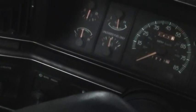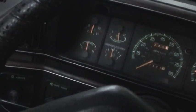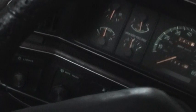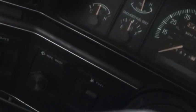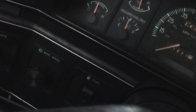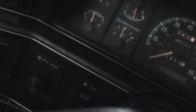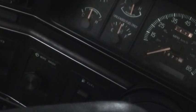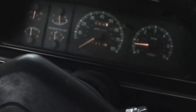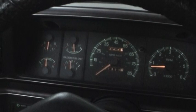So, not the easiest job in the world. A lot of the parts were heavy, and the truck had a lot of rust and corrosion on the frame and everything, and that kind of got in my face, and it's kind of hard to do everything on your back, but definitely well worth it to know how much gas you have now and to have a working fuel system. And as long as the fuel pumps don't fail next, I'll be in good shape if I get 5 years out of it. That'll be a good thing. So wasn't too bad for about $65 and maybe 6 hours worth of labor. So if you guys have any F-150s or any kind of Ford, really, that's pretty much how you would change a fuel pump, or a sending unit, or both.